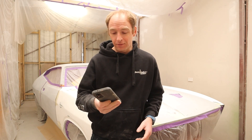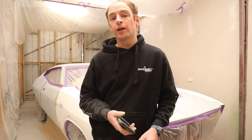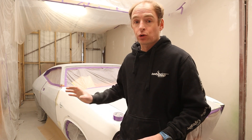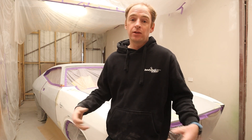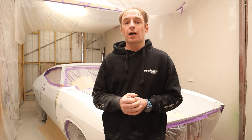That's pretty much all the questions I've got for you on this episode. This is pretty much just a quick little video to give you guys a bit more of an update on the coupe. I've basically repaired the whole car, sanded down all that epoxy primer, found out where all the highs and lows are, repaired it accordingly, and then used the DNA Paints HS Primer — I used the grey primer. Not that the colours are any different in regards to build and all the substrates — it's just solely colour. So I've primed it, taken all the panels off, painted the insides of the door jams, insides of the doors, insides of the guards, painted the engine bay, painted the dash, painted the whole inside of the car.